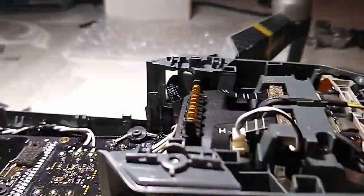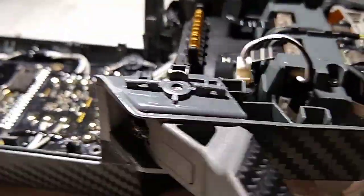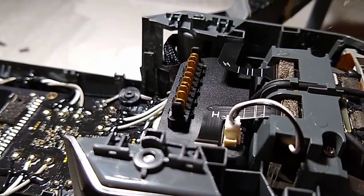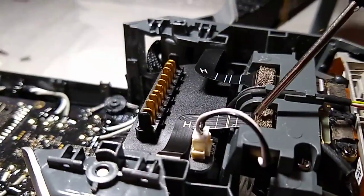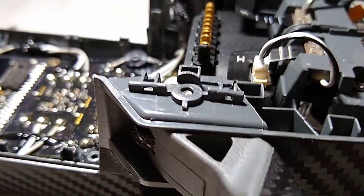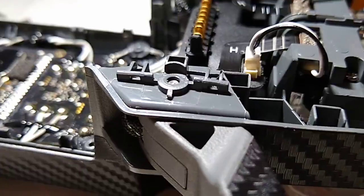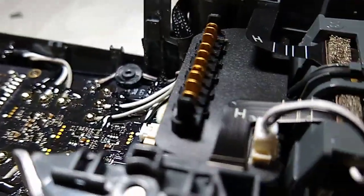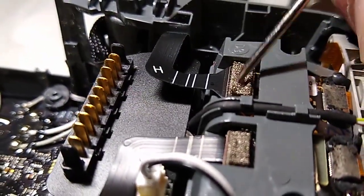So you have to rip all this stuff out, and let me give you a little pointer. Alright, here's your power cord, right here. So I already have it replaced. It's put back together. But there's your power cord. These two ribbons right there, this ribbon and this ribbon, are maybe some kind of sensor things, but they have to get locked in. So you have to be careful with them and press down. And once you get it lined up, they will click in place.